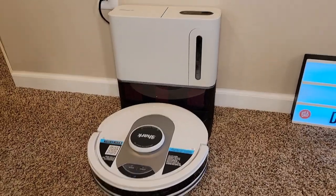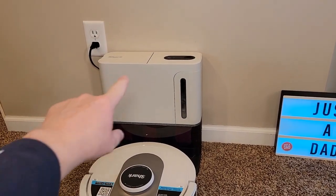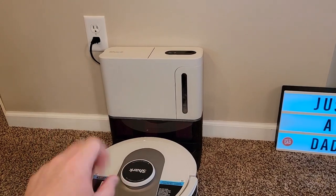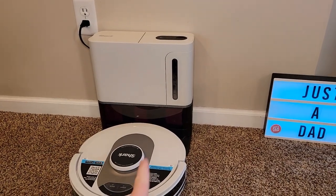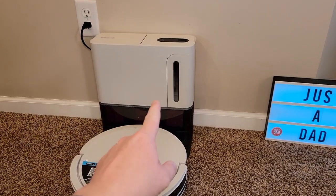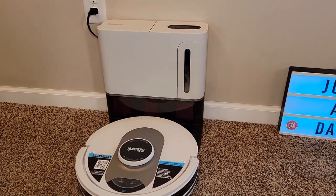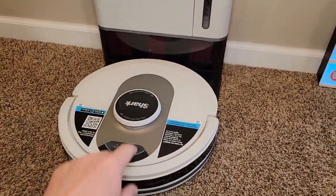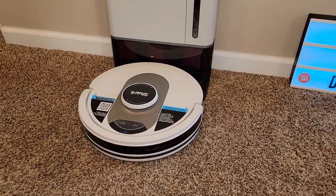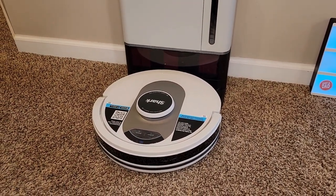With this bagless system, you do have to keep up on maintenance — there are filters inside. I'm going to do a separate video on how to clean these filters; they get really dirty and it's kind of a messy job. Robot vacuum cleaners that have bags for the base unit require less maintenance, but you do have to have a bag on hand. There is a filter inside the robot also — once a month you have to clean that out and put it back in.